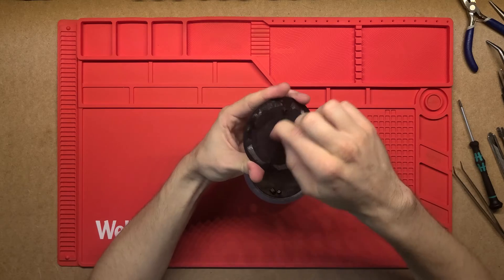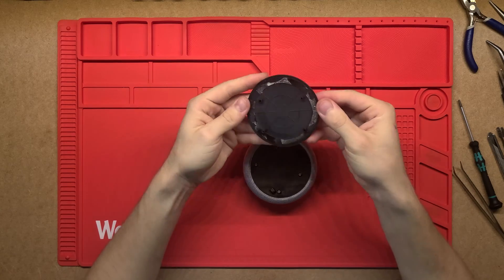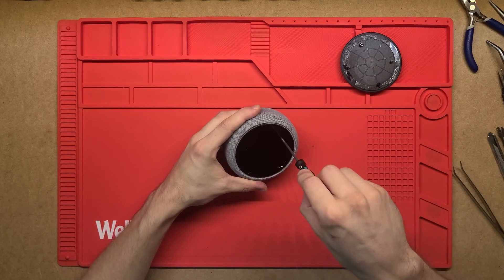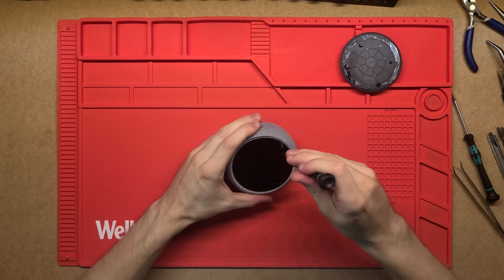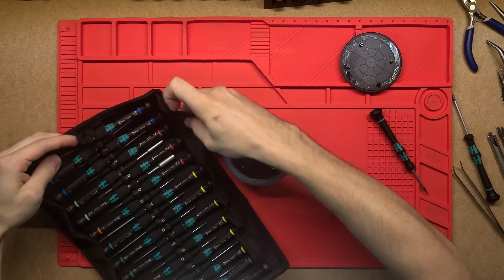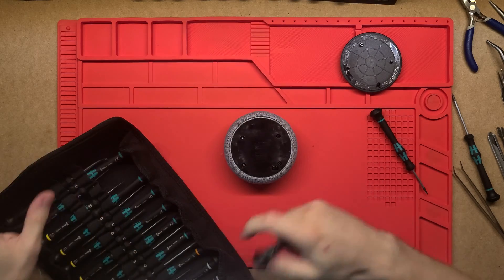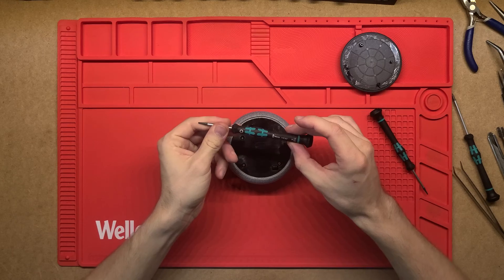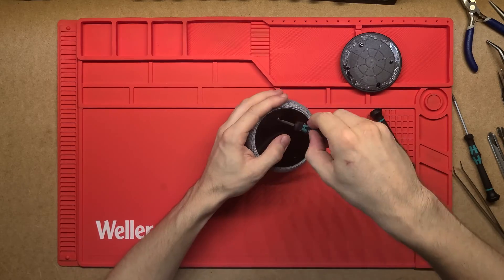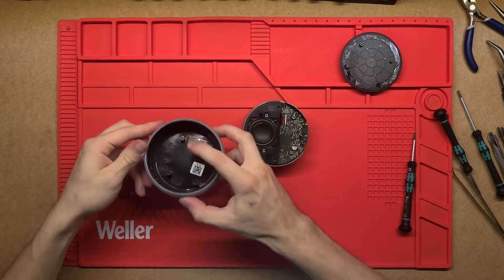Exactly as I thought - there's just a plastic bit that's overmolded with a rubbery surface. Really nicely done and comes off quite easily. There's just glue holding it on the outside but nothing too strong. And then it just has four holes for screws. They're just Torx screwdriver - Torx 6 seems to fit pretty well. Undoing those four screws, I should just take them out so I don't lose them.